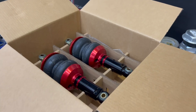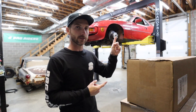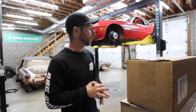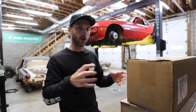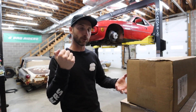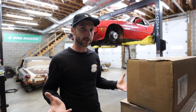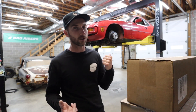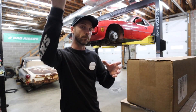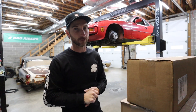The rears are using the dual bellow builder series from AirLift — it's an eyelet to eyelet mount right where the OEM shock is, where you would normally do a coilover conversion in these cars. Again, nothing cut on the body. What we did have to cut was the shark fin mount on the torsion tube itself, which is there only as an anchor point for the torsion bar suspension. Since we removed the torsion bars altogether — as if you were completely converting to coilovers — we cut that off the torsion tube and removed the bolt-in mount up on the frame rail. So again, nothing cut on the Porsche body itself.